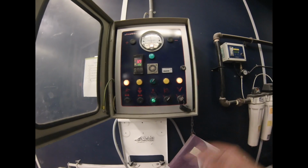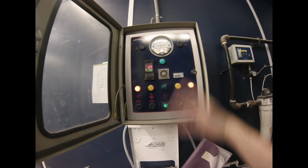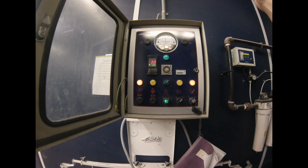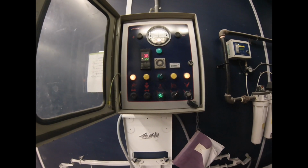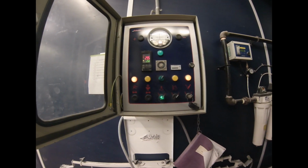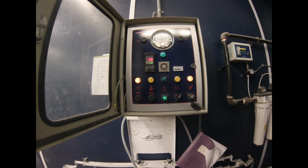And as you're painting, the filters are going to load up, and that's going to turn more positive as you're spraying anyway. So that's not too bad. It's ramping up. Now the sensors are going to say, well, there's too much heat. It's going to bring it back down, and it'll level out at 25.0 or whatever you set it to, following your technical data sheets and recommendations to the paint company.